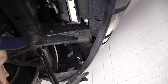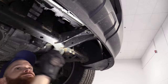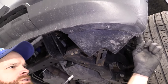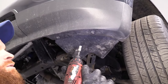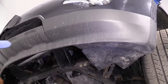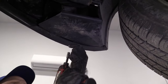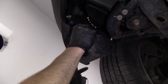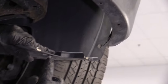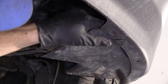We're going to remove a couple more bolts here and get the lower part of this thing moving, then go back up top. This part right here is part of the inner wheel well. We want to remove these two bolts — continuing with our seven millimeter, turning these to the left. It slides out. We've got a little triangle here, so when you pull it off and put it back together, that triangle is going to go back under there. Just holds it; you can put your bolts back in.